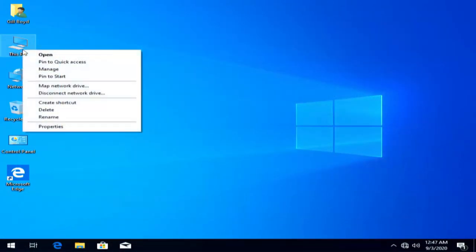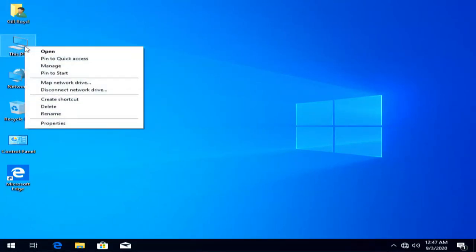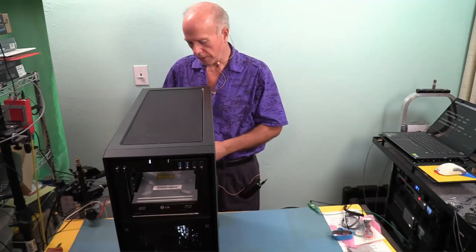Let's plug in the network since we've got to go get some stuff. Let's take a quick look at Device Manager before we go out. Right-click This PC, Properties, Device Manager. We have 'other PCI device' - so we've rebooted and my concern would be if we had the Thunderbolt card, that would be what's causing this. This is why we need to step through this one at a time. We've installed the drivers but we're apparently missing a driver - could be something with the system management bus or a timing driver. We need to go out and get the AMD drivers and let Microsoft interrogate the machine. This is our Sabrent Rocket 4 - our 4 terabyte boot drive.